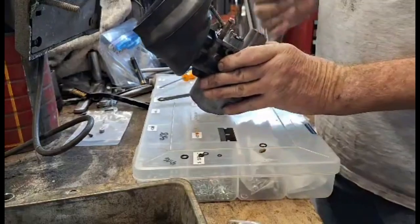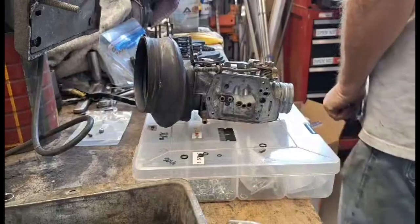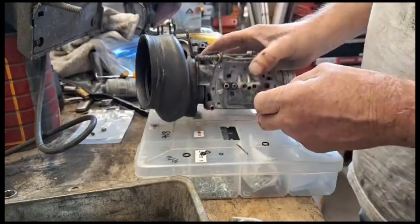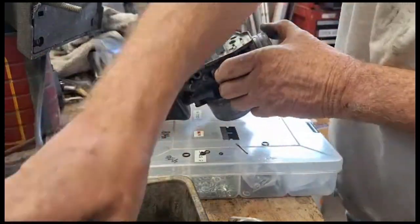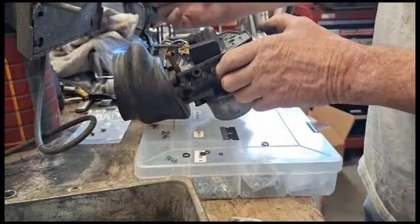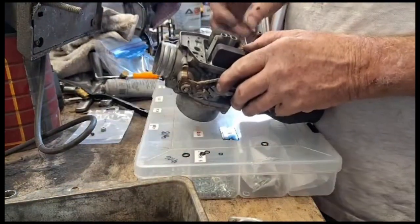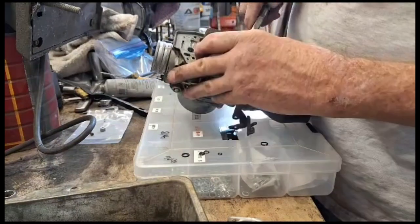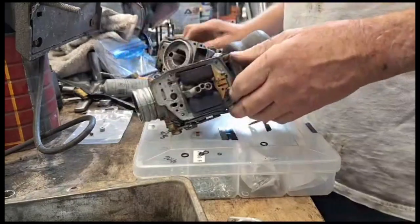And I totally destroyed my axle for the float, so I'm going to put a different one in. Needle for the float. The springy side goes toward the float. You set it in there, and you put the float back on. And like I said, I had to get a different axle because mine was destroyed. It goes in there like that, and give it a little tap.